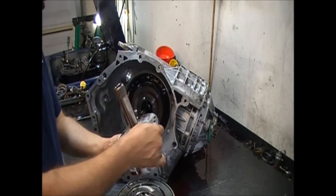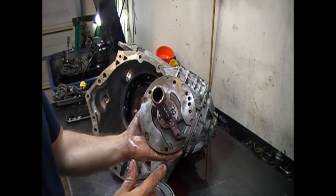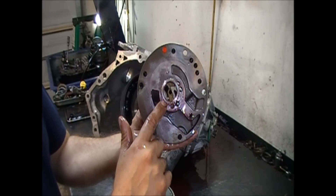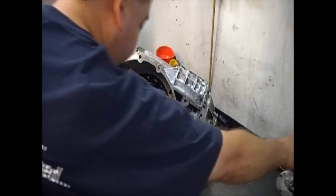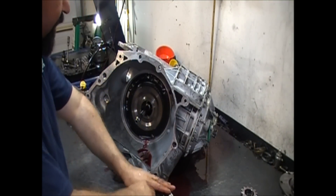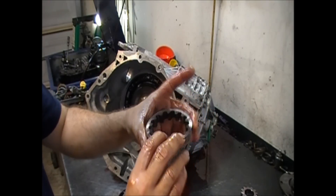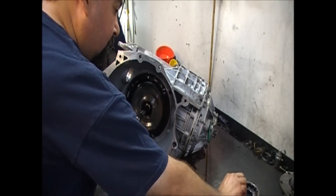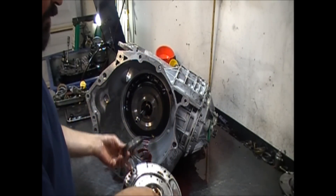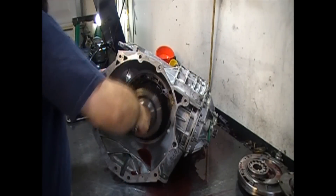This is our pump stator. It's very common on Chrysler units that the torque converter clutch ends up in the pan — it gets destroyed and these little filters get contaminated with torque converter clutch material. That's not the case here because they've been working on it and couldn't get it out, so this unit should be fairly clean. The pump is a little discolored but you can still see some blackness on it. Once you see it all nice and chrome and white with the pump gears black, get your feeler gauge and check clearance. But if you can still see black on it, you don't have to worry.